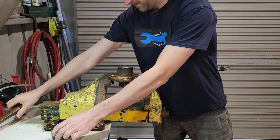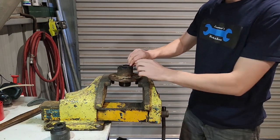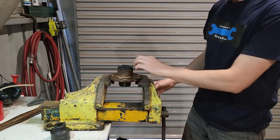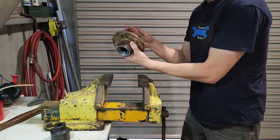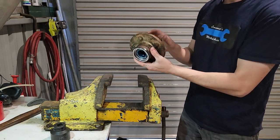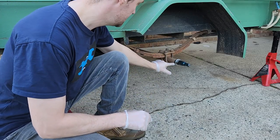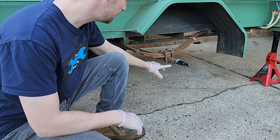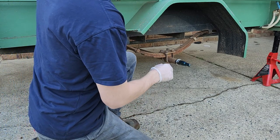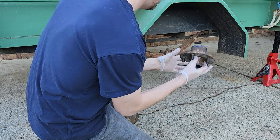The seal is in - super easy. That also holds the bearing in. The stainless part just sits there held by a shoulder on the axle. We'll fit the outboard bearing then slide the whole assembly onto the shaft and adjust. I've put a bit of grease on the shaft, cleaned up the seal area with sandpaper, and pushed the stainless shim for the marine seal onto the shaft. We grab the seal boot, stick it in the back so we don't forget it, and get the whole unit on.